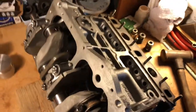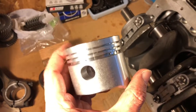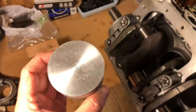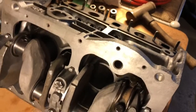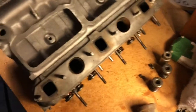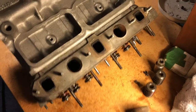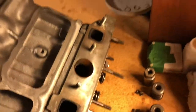The goal here has been to modernize these engines. We wanted to hugely overbore them using 68-millimeter pistons available from our friends in Australia, Russell Piston — though 'available' is generous; it took me 14 months to get these. This may not be the easiest or most affordable setup. We've offset the cylinders quite significantly to move the combustion chamber into more favorable alignment with a 1275 head — in this case a 1316, the North American smog head from a 1275 Sprite core, lightly ported.